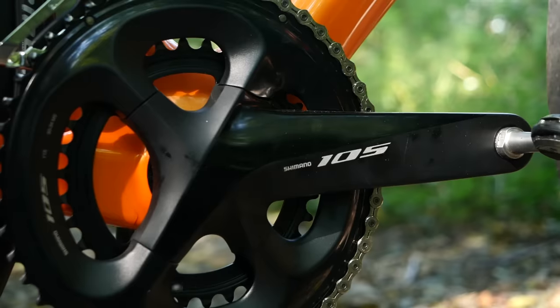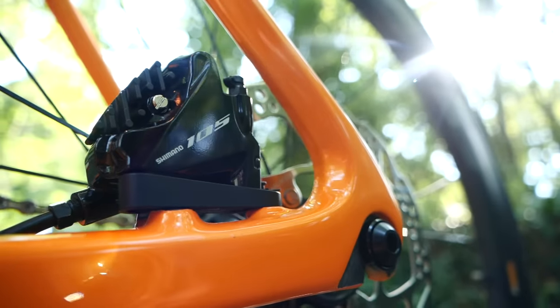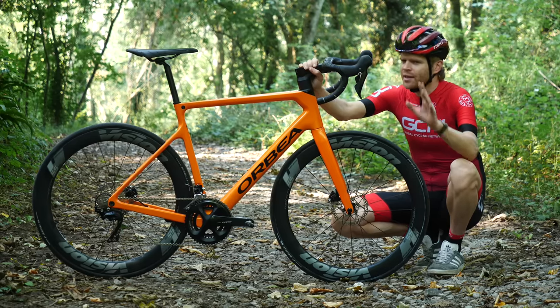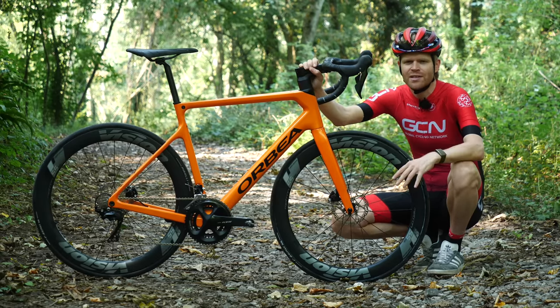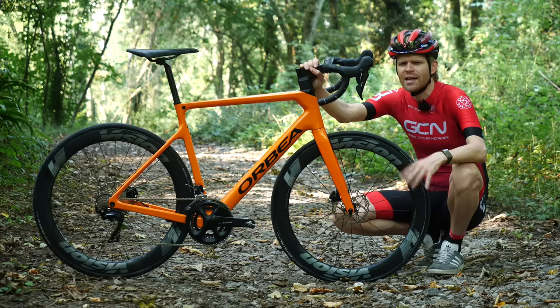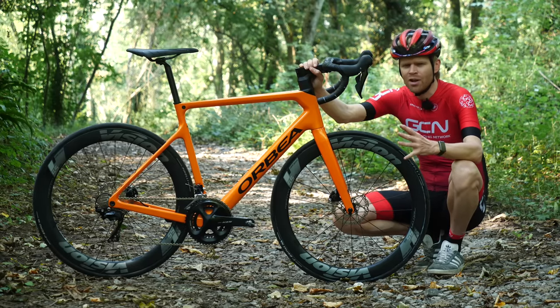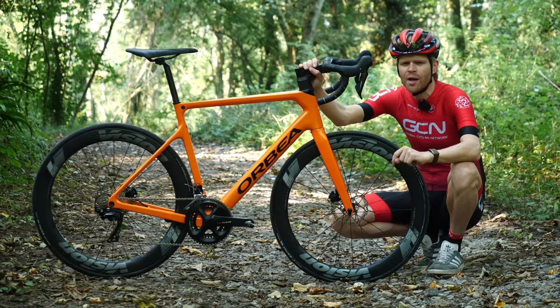Shimano 105, the groupset of the people. Yes, Dura-Ace, it's the best of the best. It's what the pros use. It features the lightest and most sophisticated materials paired with the most cutting-edge design ideas. It's a tool that's designed to help the world's best cyclists win the world's biggest bike races.